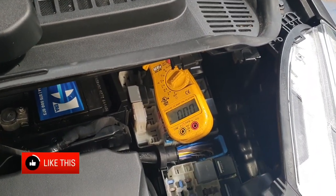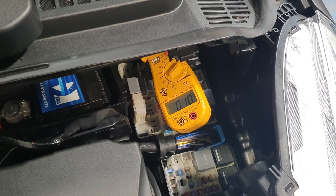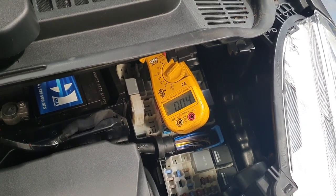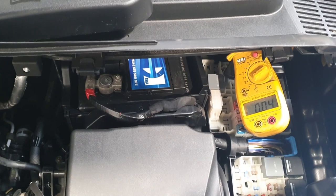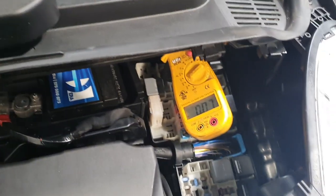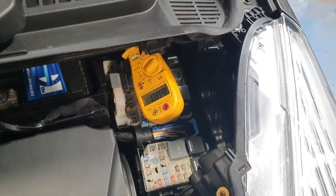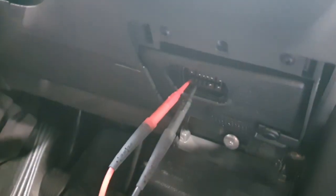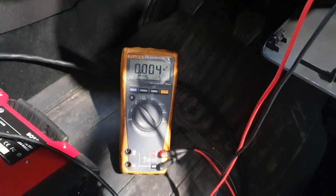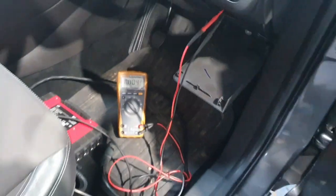About 40 minutes later: the inductive clamp is ranging a little, but we're shutting down to between 30 and 70 milliamps. Compared to the two-amp drain we had before, I'm happy with that. Checking the CAN network — I'm on pins 3 and 4, medium speed CAN — and it's shut down to zero volts. So two door handles needed replacing.